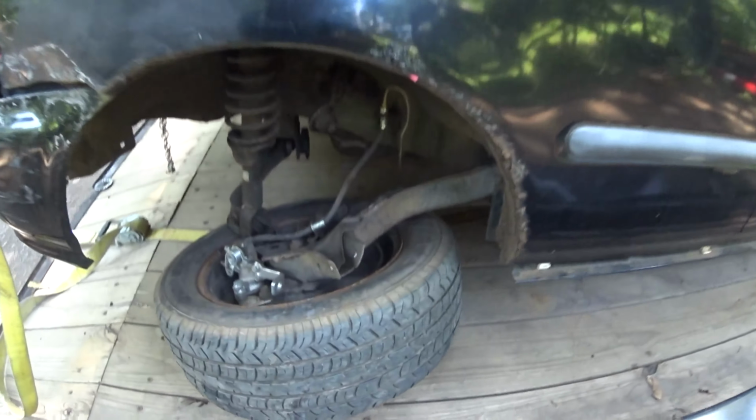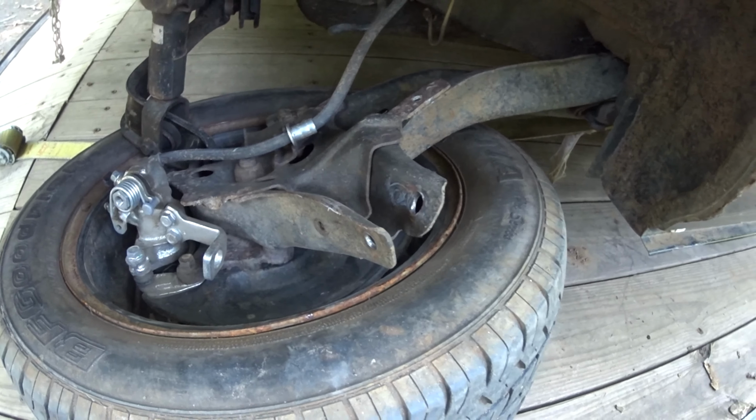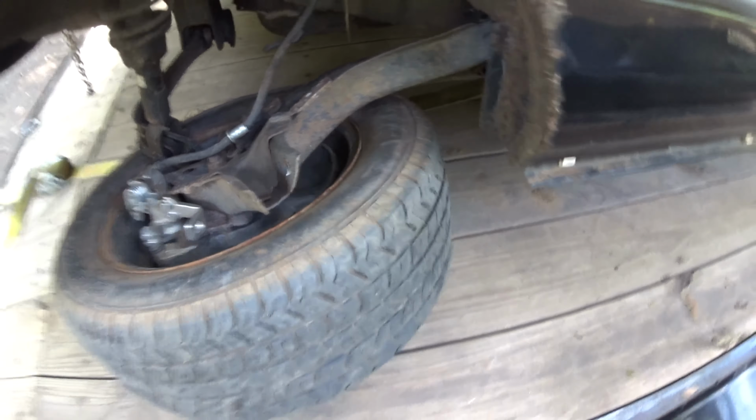I guess one of the bolts for the right rear upper control arm came loose, either that or broke off. As you can see, the hole is elongated, so I don't know if it came loose during racing or if it was from the race before. Either way, now that's one more thing to check before every race for the Honda anyway. Make sure all the bolts are tight.